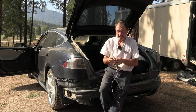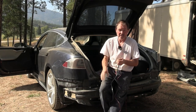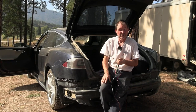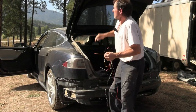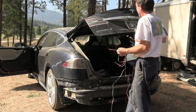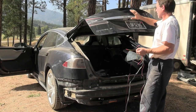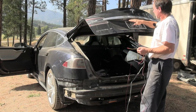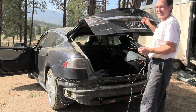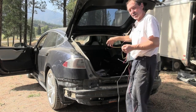The only thing I can do is I need a light source that doesn't flash. Well, there's a light source that doesn't flash when you set the turn signal. Your tail light will, but here on the tailgate we definitely have license plate lights, two of them. They won't flash. Those two lights have their separate wire coming from the body control module.